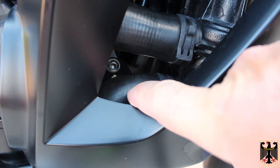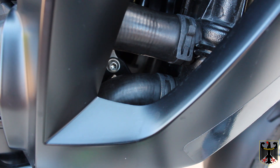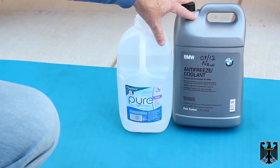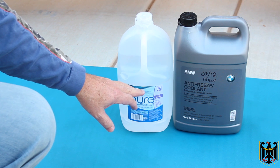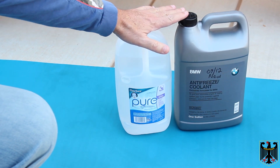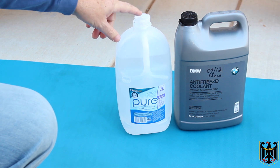I reinstalled the bottom hose after taking all the liquid out of the heat exchanger area, so now the system is basically all sealed back up except for the radiator cap. To make your solution, you're going to make a 50-50 mix — I use genuine BMW antifreeze coolant and purified water. It's not distilled and not deionized; purified water has the mineral content reduced so you won't get mineral buildup in your system but it also won't leach out the system. Mix these 50-50 and pour it into the radiator fill area.